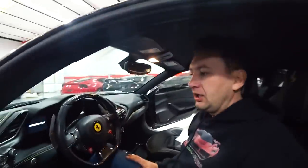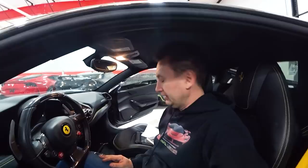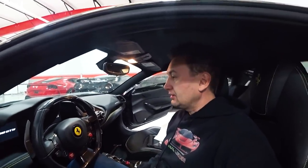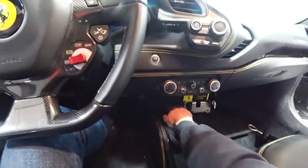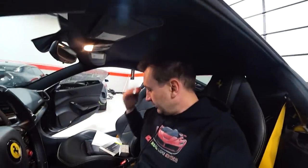After the alignment, a lot of lights are gone — no problem there. But this car still has the airbag light on. I'm gonna take off the center console, and over here is the airbag ECU. I have to replace this airbag ECU, and after that I just clear the light and it goes away.